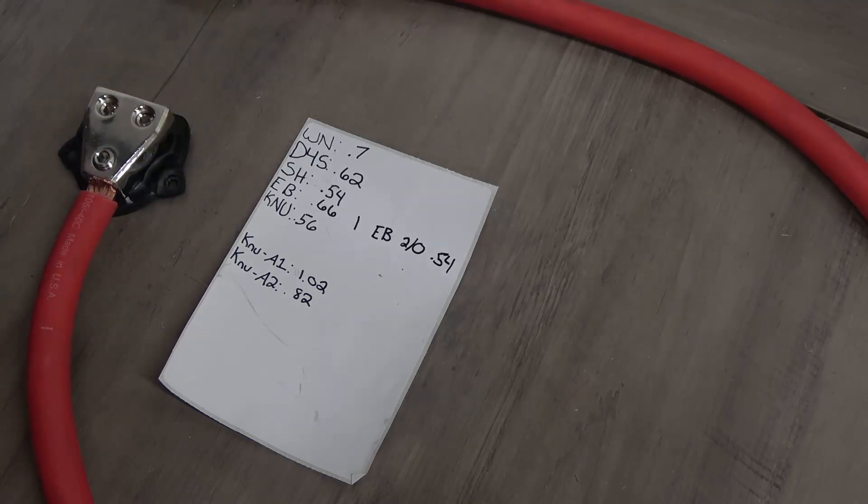Here's our stats. What I'm going to do now is create something so you can visualize what these numbers mean against how much current. I'll be building out a simulation where if we're using 20 feet of this wire, what does that mean — going from the front to the back and checking out what kind of voltage drop we have. Because with these numbers, we will know exactly how much voltage we should lose because of the wiring.